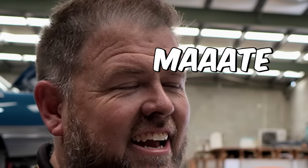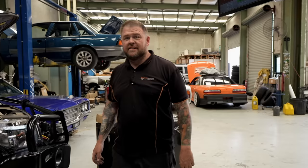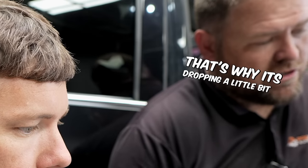We're back — the tune is in and loaded. Running it on the dyno now, targeting 20 to 30 percent power increase. The intake temperature is currently at 40 degrees and the fan is pulling the intercooler temperature down. Shane explains that if I had an intercooler, that intake temperature number would be much closer to the actual ambient air temperature.